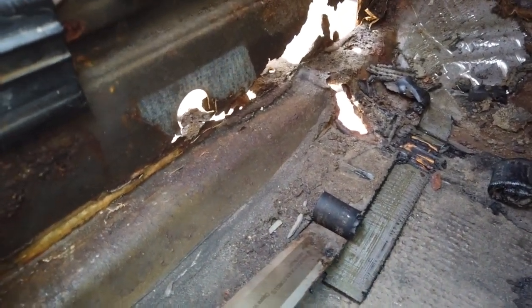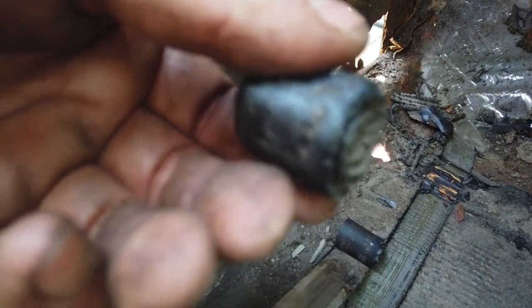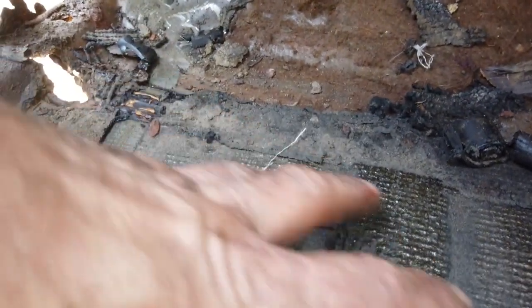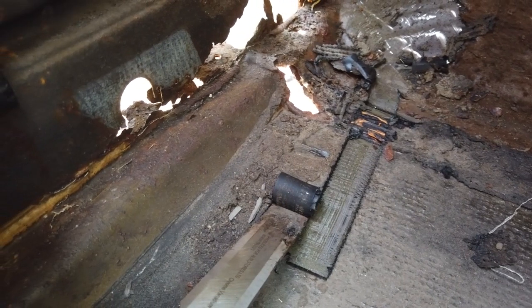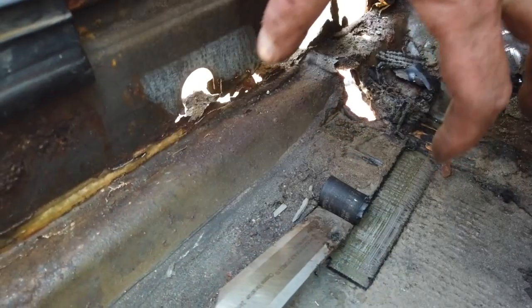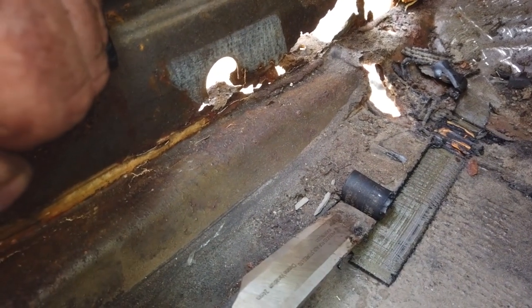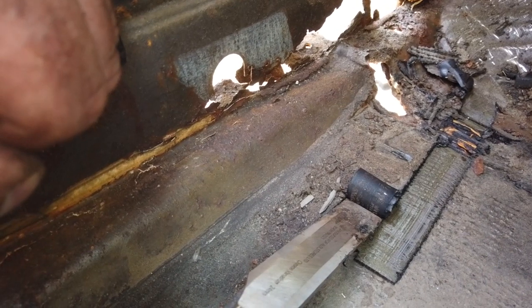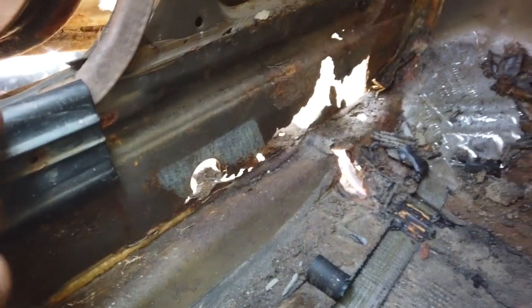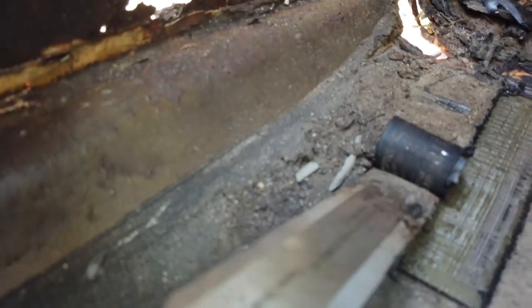Here's how I take out the soundproofing or mat - the tar pads. Go in lines, neat and methodical. You've got your chisel here, the air gun underneath the chisel heating the blade, you've also warmed the floor up, and you're just going to unscroll it in nice sections. On this car we probably don't need to go inboard - we'll go along that strip there but we don't need to go right the way inboard. I don't think there's any rot that way. Look how we're doing it - just scrolling it out there like that, keeping it neat.